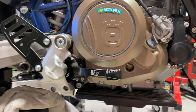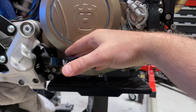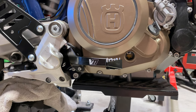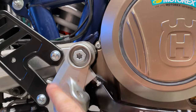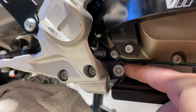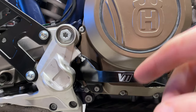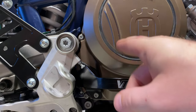One thing I don't know about is fitment — will the carbon fiber cover I bought have okay clearance with this? We'll have to see. I think this is really, really nice. When putting this all back together, you want to marry this up directly against the swing arm and that lower carrier, then kind of tighten all these down hand tight until you get resistance on all of them.